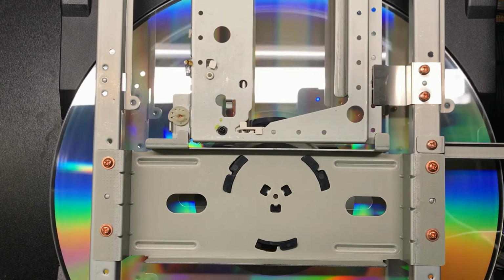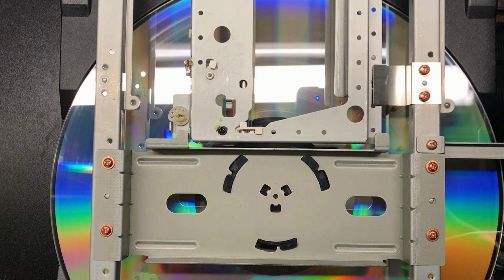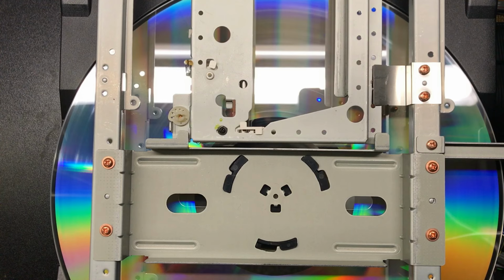That sound is what you'll hear when your grip ring is going out. It's probably not as easy to hear it when your player is closed, but that whoosh sound, definitely need to at least clean the grip ring, but replacement is normally what comes next.